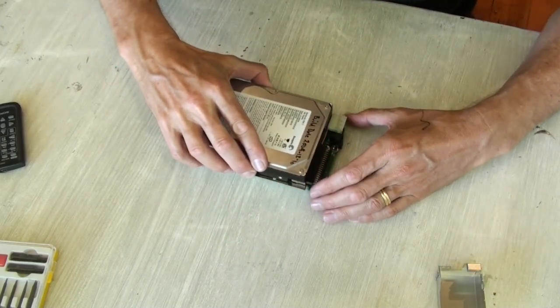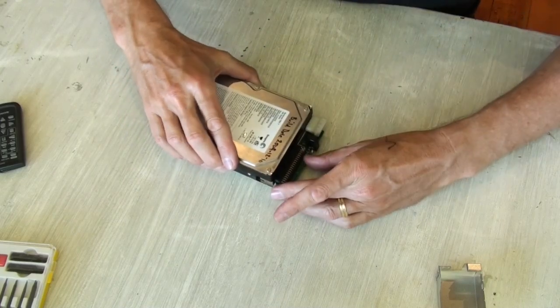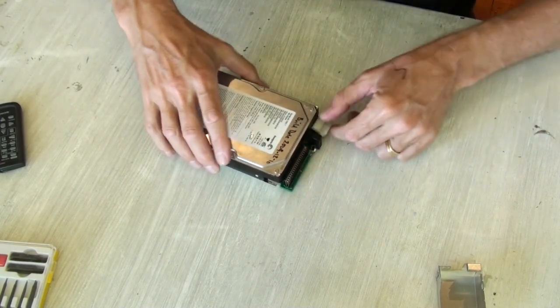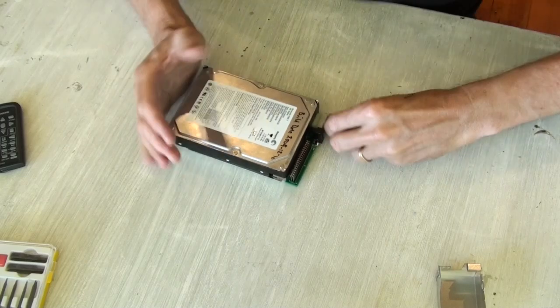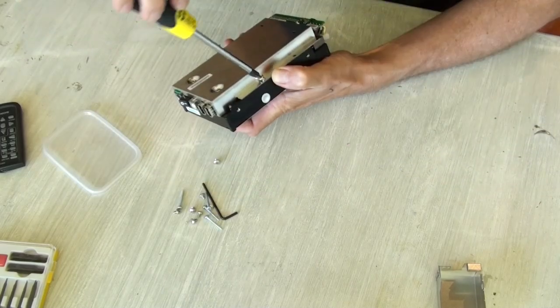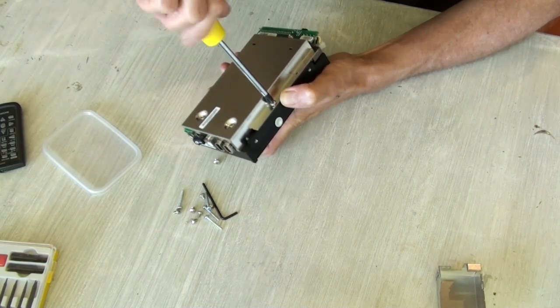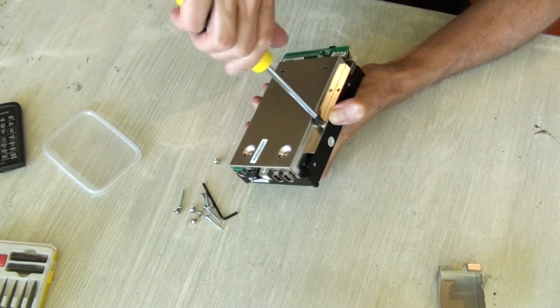As a result, I'm stuck with reinstalling my 160 gig hard drive. So here's how you do it: align the pins carefully — it's easy to get them out by just one row — and push the power supply connector back in with quite a firm push. Then mount the hard drive to the bridging card.